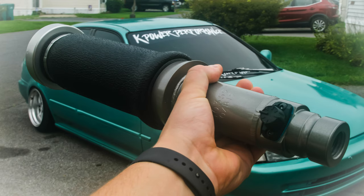When you buy the struts, they're not going to have any top hats on them — they'll be bare. They do that so you can take top hats from your stock suspension or aftermarket coilovers and put them on the airlift struts. My coilovers were TruHarts and I had TruHart top hats, which are practically two inches thick. The issue I'm having personally is my struts are too tall, so I can't go as low as I want.